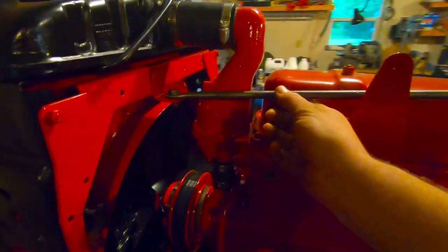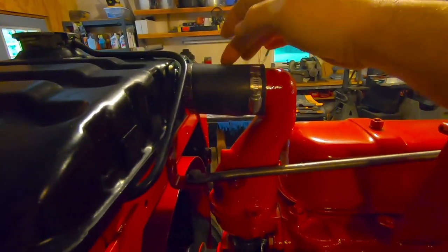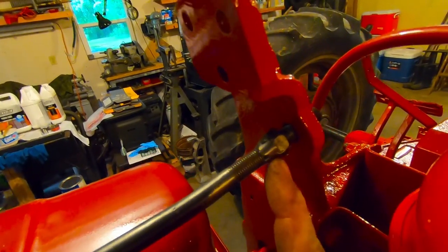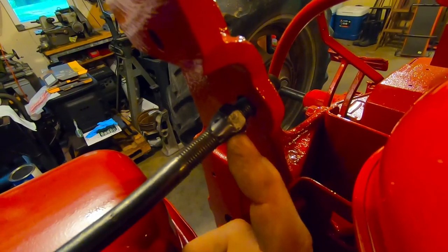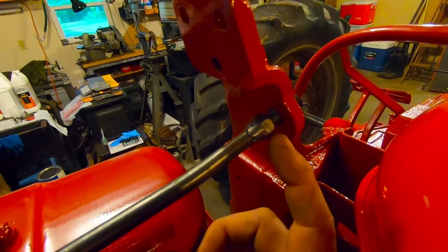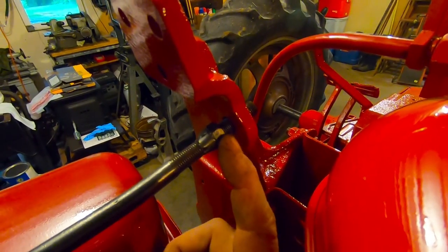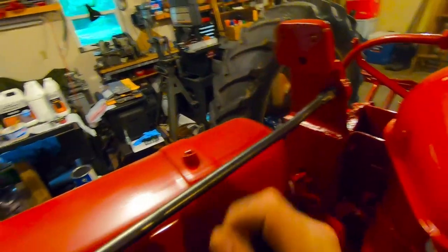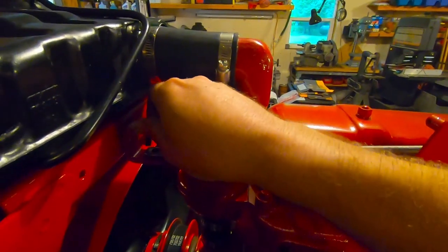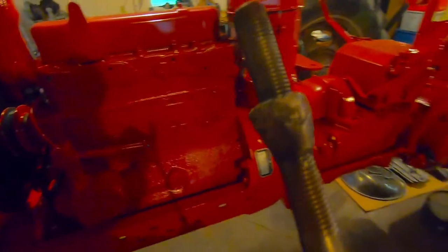This brace rod just braces the radiator — there's so much leverage up here, it helps out the upper hose connection so it doesn't fatigue too quickly and makes everything a lot more rigid. It bolts in up here at the front. My issue is where it kicks up slightly and goes through the through hole in this bracket back here. Some previous owner has put weld where weld should not be. I don't know if they were repairing a crack — but I'm a good quarter inch shy of where this jam nut needs to be. I should be able to spin the nut up against there, then another one goes on the outside and that locks the whole thing to a fixed length. I need to figure out how to repair this.